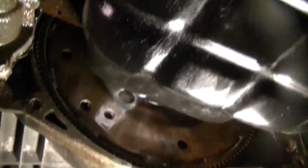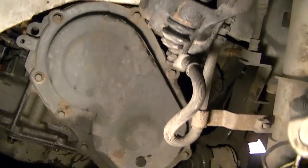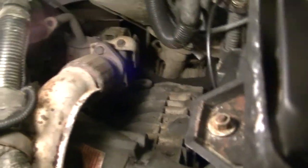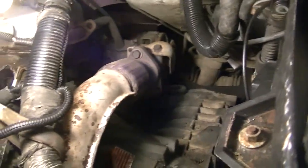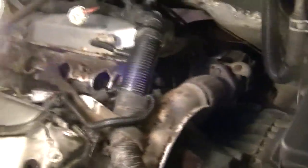It's ready to come out. What I have to do is put a jack up under this, go ahead and get my transmission jack, prep it, and once I do that the last bolt comes out right here - take that deep bolt out and it will release it from the motor mount. I can go ahead and drop this transmission down, separate it, get in there, take the flywheel off, and see where my leak is. I'm going to take those three bolts out that I just showed you and those couple bolts on the bottom. I've got one up here on the transmission that I left there for safety reasons - I'll take it out very last. Then we'll drop this transmission out.